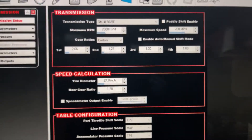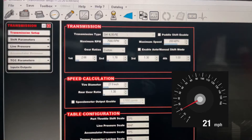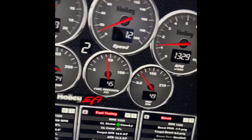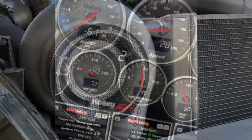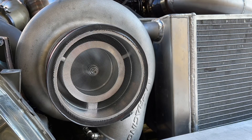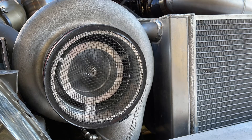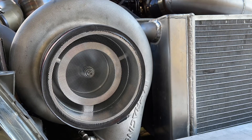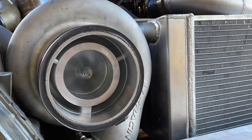After that, you can verify using the TRC app. As you can see in the screenshot I took while driving, the TRC app matches my in-car app. The vehicle speed is being displayed correctly, and from here I can dial it in. That's how you set up a vehicle speed sensor with a manual transmission — in this case a T56 — with the Terminator X Max, and it only cost a couple bucks and some time.